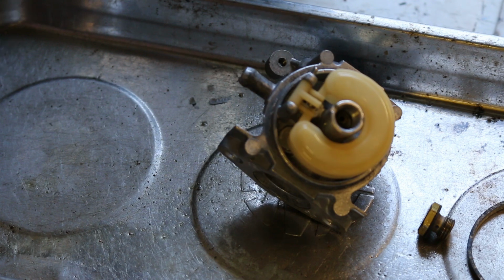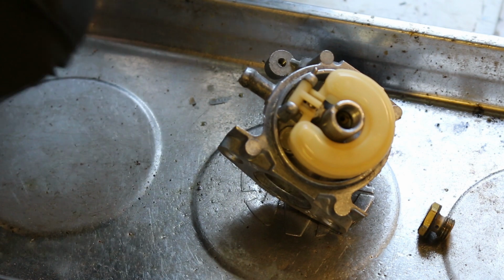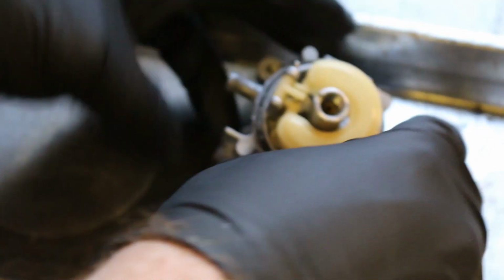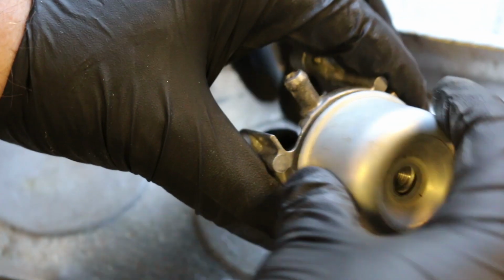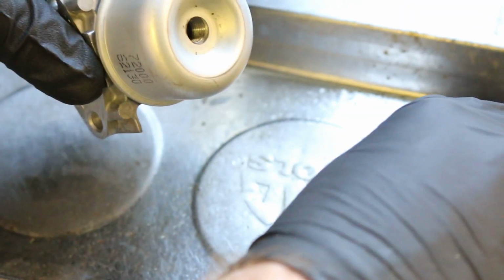Schmoo be gone. Doesn't matter what position our float bowl goes in. Does matter if we put the seal on though. Be a little gentle with this O-ring. Don't hit it with anything crazy for cleaners that might attack the rubber and make it swell, otherwise you're in trouble. Just set it on there and make sure our bowl goes down over top of it. Easy peasy, nothing to it.